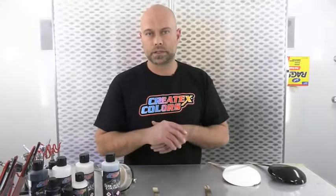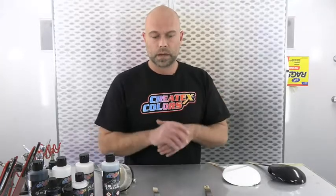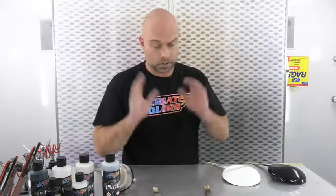The premium would be two days — 48 hours — after which it really brightens up; at minimum 24 hours. If you saw our Silver Surfer video, we waited two days before applying the clear to achieve maximum brightness. As it dehydrates and dries, it actually does brighten up. So now I've got my gold chrome in the gun ready to go — right out of the bottle, ready to spray.